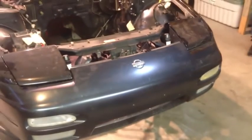All right, well, looks like another spot of screws that hold the front bumper of a 240 on are located just in underneath. If you take a look up, there's one, two, three, and four. Fourth one is out. That's just a little tiny metal bracket that pinches your plastic, urethane, whatever it is, up against your core support. And it's not necessarily needed. It all depends on what you plan on doing with your core support. Some of you guys that are turboing like me might not keep it. But anyways, I think that's pretty much it that's going to hold that bumper on.